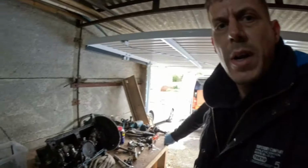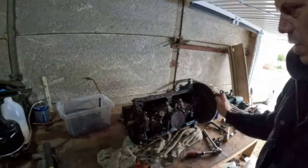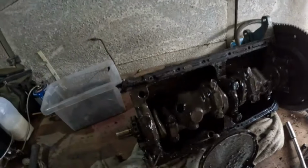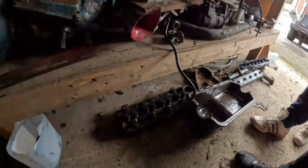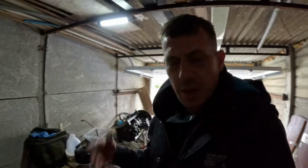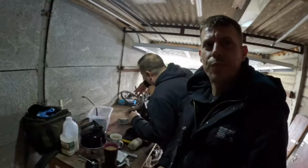So that's it stripped down, definitely not seized. You see it's all turning. See the pistons going up and down, crankshaft turning round. Just wants a clean out then. Got the sump off, head off, all the other bits. I'll clean it all up, get some new gaskets on there, and put it all back together. That'll probably be the next video though, so we'll see.